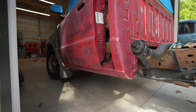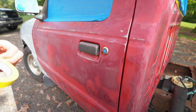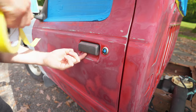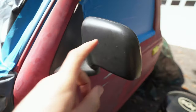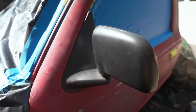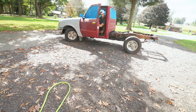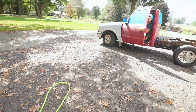The car has been sitting overnight and I have more clear coat to finish the job. Tip number seventeen: remove all the rubber and plastic molding — don't just tape things off. This is even more true for the mirrors — you have to remove these, or at minimum tape them off. We're not going to do either — let's see if the paint sticks. Trying to follow my own rules, we're going to see if we can get the car out from underneath the tree.